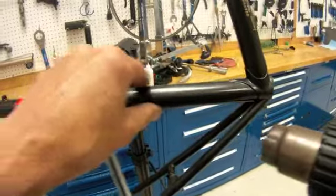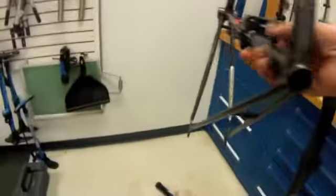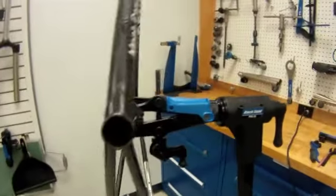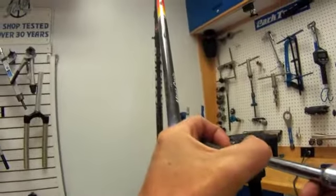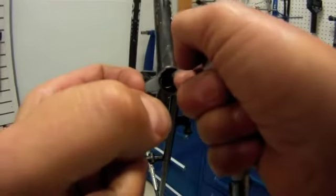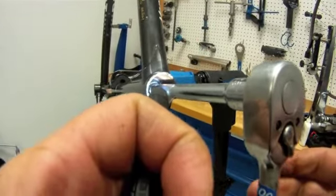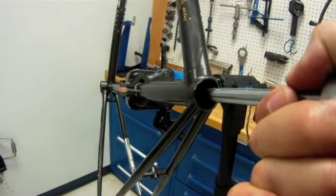We're going to attempt a little warming — not too much. It's an aluminum piece inside. We're going to try and really disrupt the bond between the two surfaces, so just a little bit of heating there. We have a pretty good fit inside the hole. We need to catch that wedge shape — that plug — in there, and we're going to turn it only counterclockwise due to the nature of the shape of that slot. Been oiling this every day. Let's see if we have any luck.